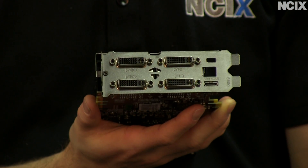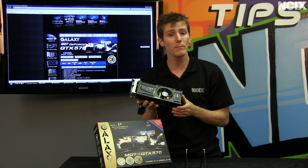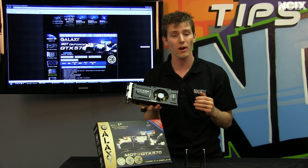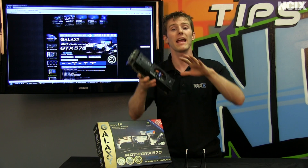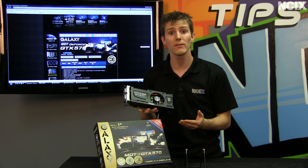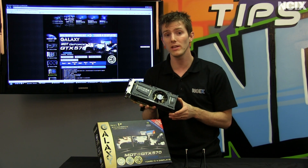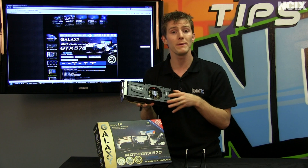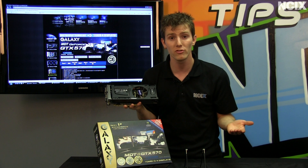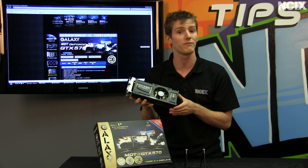It's got four heat pipes that take heat away from the GPU to an enormous fin array. It obviously has more ports on the back of it than a normal GTX 570, and it has 1.28 gigs of RAM. Now this is one of the things that may be a bit of a performance bottleneck for this card, especially in very widescreen gaming at large resolutions such as 3x1080p. However, if you are running three smaller than 1080p monitors, that shouldn't be an issue. And if you're not going to be running it in 3D, and instead using it for more of a business application where you just need multi-monitors off a single card — maybe you need a powerful GPU for CUDA acceleration for video editing or whatever else — then this could be a perfect solution for that as well.